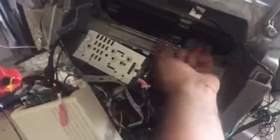Now you want the wire to go above your handlebars. You can't see it, well, there's a gap in there. You can see the wire goes above the handlebar. Simple. Now also, before you mount your radio, you're going to have a tab right here. It's just sticking out, a piece of plastic. You want to cut that so that the radio, when you put it in, it won't hit. It'll be nice and flush. Okay? Let me show you the front.